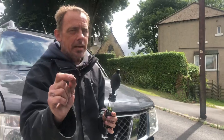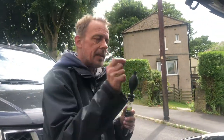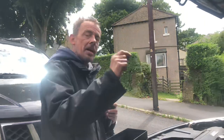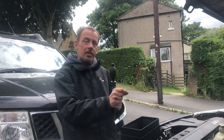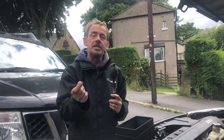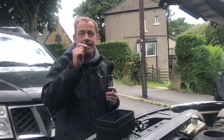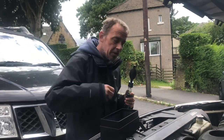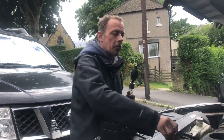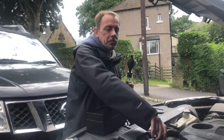It's not good news for the owner of this vehicle — this head gasket has been cooked. As I've been telling you in previous videos, these are not easy to fix. You can't just go for the head gasket and expect to fix the car. This has got a DPF issue which has caused this problem. Once we've dealt with the head gasket and the pressurising of the coolant system, we'll move on to that. If you ignore it, it'll do exactly the same thing in a matter of weeks, or as soon as the vehicle is put under heavy load.